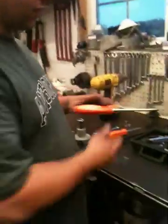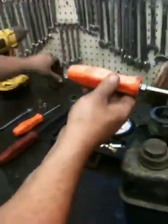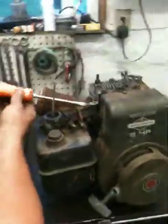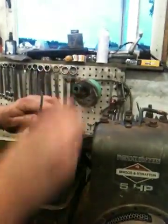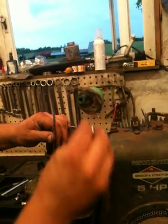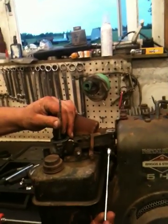All right, we'll disassemble and take the carburetor off. We've already taken the cover off — there's the air filter over there. Here are the bolts; we already took the one underneath. There's one underneath that we just loosened up because they're usually pretty hard, and there is gas still in there, just so you know.